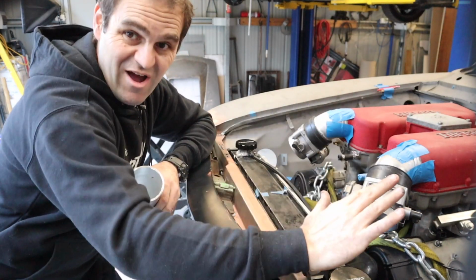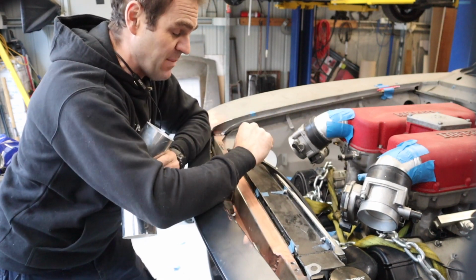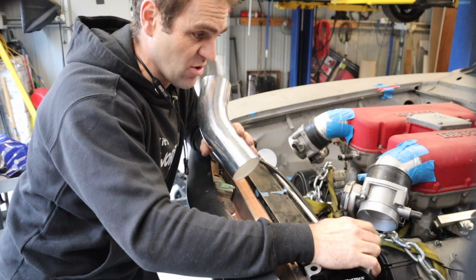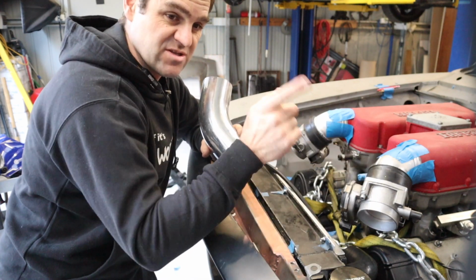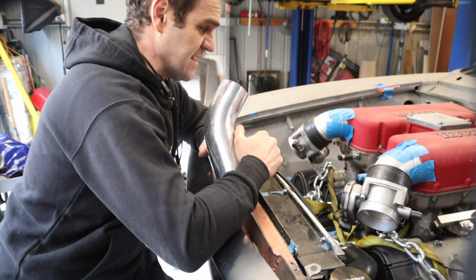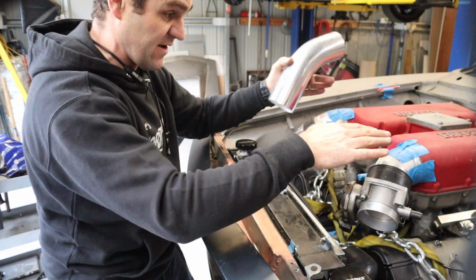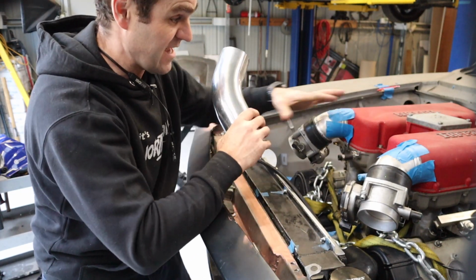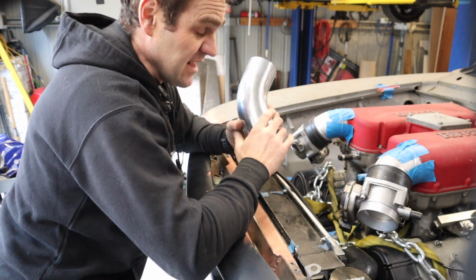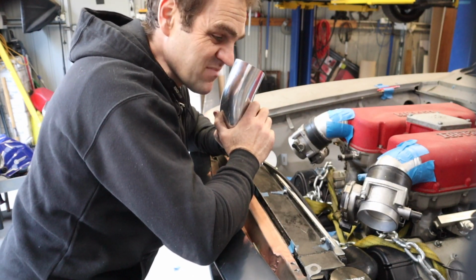Alright, so sitting these on slight angles actually is going to work a lot better. At least on the driver's side, we should have enough room here, but on the passenger side, it's a little bit tight, and that's because we have the radiator outlet right here. So what I'm thinking is I'm going to cut up another bend and make the bend go a little bit further around before we join on the throttle body, and I might even replicate it on the other side so we have it relatively even. These are not perfectly evenly spaced, because the banks are not even anyway. We have this bank sitting slightly further forward than this bank, so they're not perfectly symmetrical to start with, but I want to still make it look neat and tidy. So let's try and cut out another slightly larger bend and see if we can work things into it to make it just right.